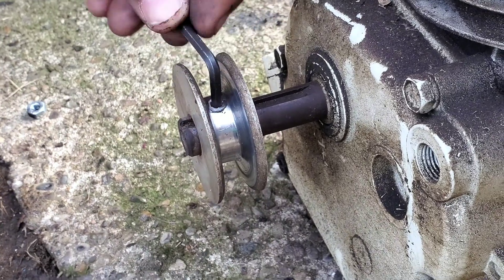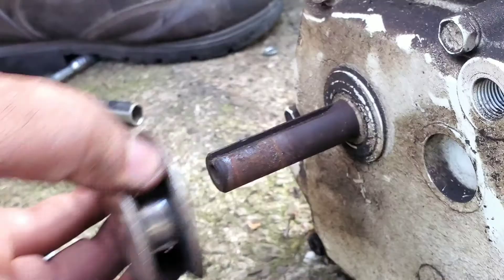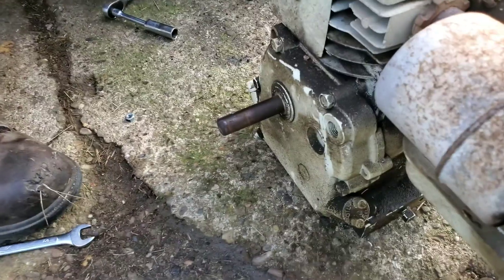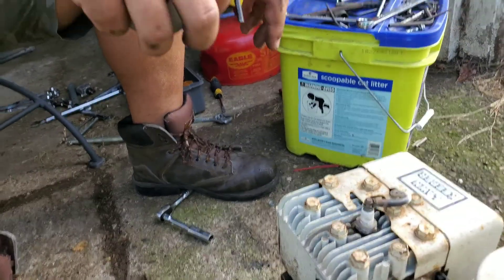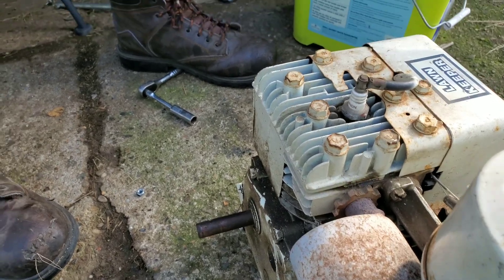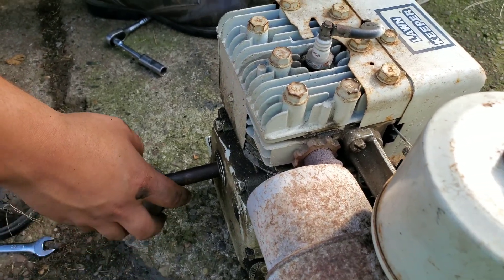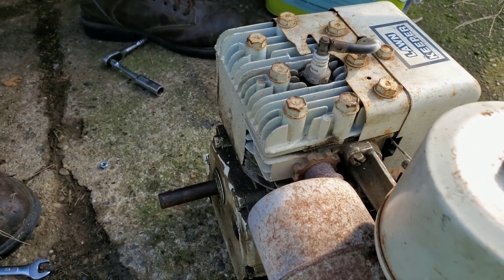There's a set screw right inside this pulley. You just get your allen wrench inside of there and go — righty tighty, lefty loosey — and then it pulls right off your shaft. As far as this engine, this is a 5/8 shaft because it's thinner than the regular 3/4 shaft. I have a 5/8 clutch somewhere for that mini bike. Anyway, this has been a good video. Like, comment, and subscribe. Go Tigers — beat Austin Town Fitch, and have a good day!